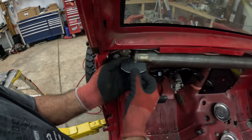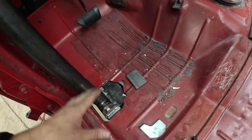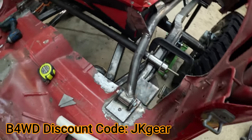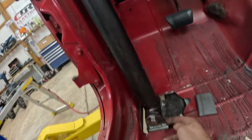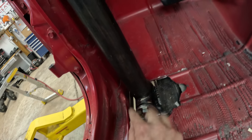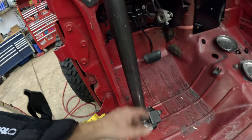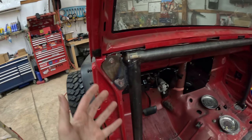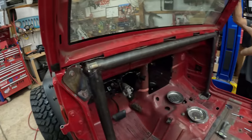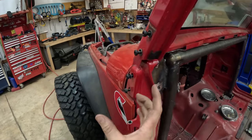It's time to loop you guys into what's going on with our dash hoop, the first piece of the puzzle. We start off down here at the frame - the Barnes Four Wheel Drive leaf spring outriggers onto the frame bring it out and give us a super solid base to mount our roll cage to. We have solid bushings inside the tubing and tabs kicked off. We also tied this into the A-pillar of the body to structurally bring the body and roll cage together.